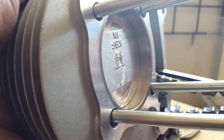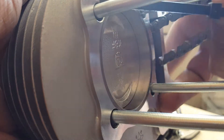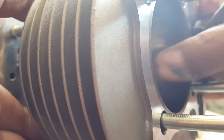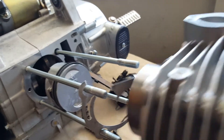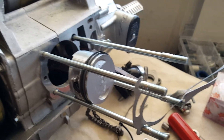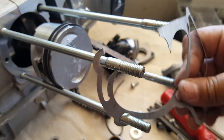Now we're going to go ahead and start pulling them out. Keep your chain and everything nice and secure. You can even push back a little bit on your pistons from within. There it goes — there's your pistons. The tie strap doesn't just get in the way, it actually helps. This one came out with it — that's a gasket that was on there previously, but it wouldn't matter because we're changing it.